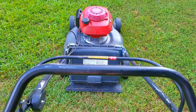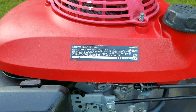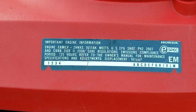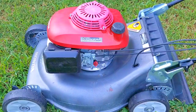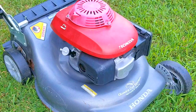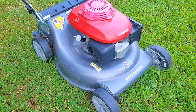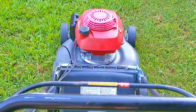I've got some hard decisions to make. I have to get the self-propelled working again — that's why the wheels are locked up — then replace the carb and the gas cap (which is currently from a different engine). The recoil also needs to be restrung, and on top of that there's the hole in the deck to fix. Parts alone will cost at minimum around $40, not including the pull rope string or new wheels and tires. The self-propelled repair and the deck hole could push well over 20 hours of work. Another option is to simply transplant the engine to a different deck that has a working self-propelled, no hole, and decent wheels. So — should I fix all its problems, transplant the engine, or just use it for parts?